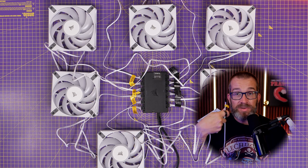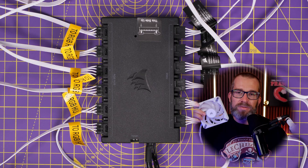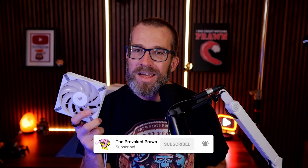So this included a fan like this, for example, which has these two RGB hub cables on it. It's important to note that the new Commander Duo doesn't work with these — you need a Commander Core for those sorts of fans. There are a lot of different variations: the QLs, the LLs, the AF120 Elites — loads of different RGB fans with these two cables on them, and they were always a complicated mess to wire.